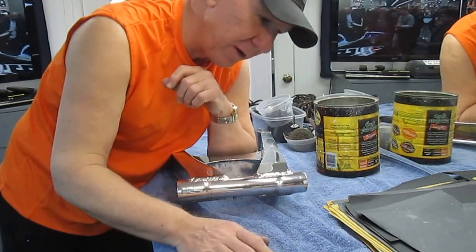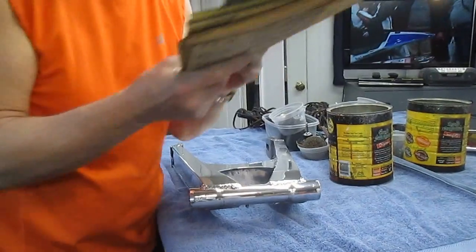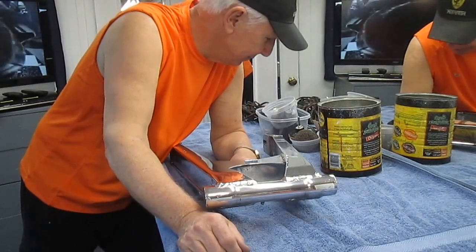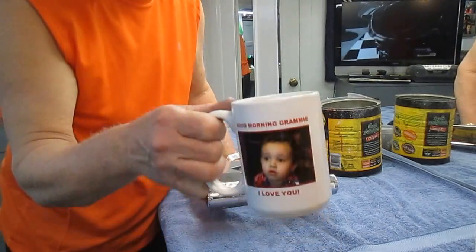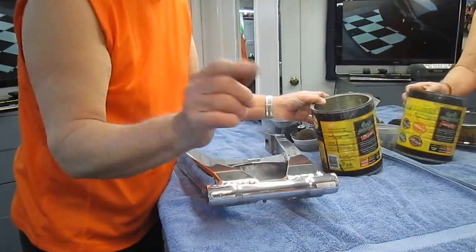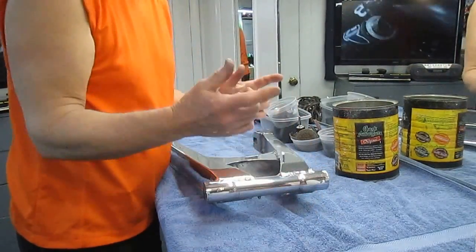From 220 to 320 to 600 to 1000 grit — each grade, sand the scratches one way and then the other. At some point you're done sanding and you start thinking, 'Why didn't I just pay somebody $400 to polish this?' Well, I don't like paying anybody — frugal is the right word. But now you have the sanded part and you're ready for the next step.